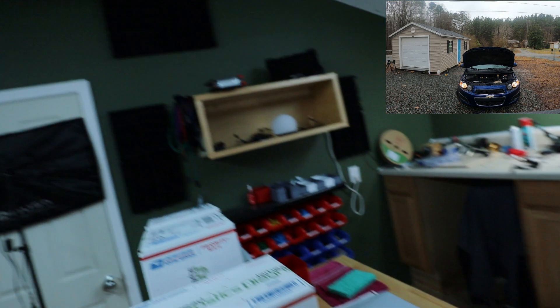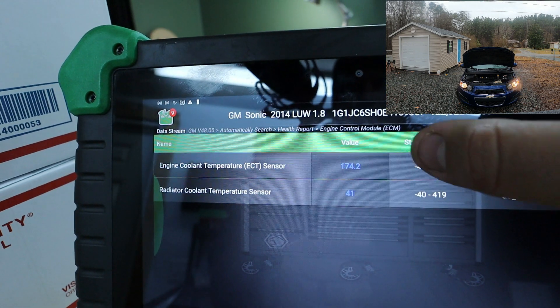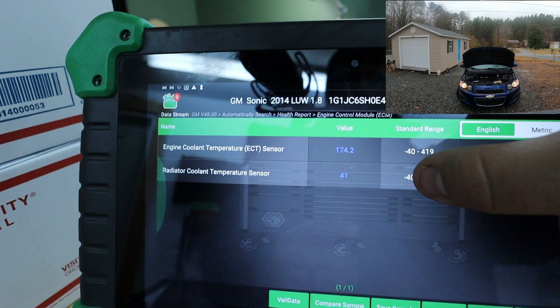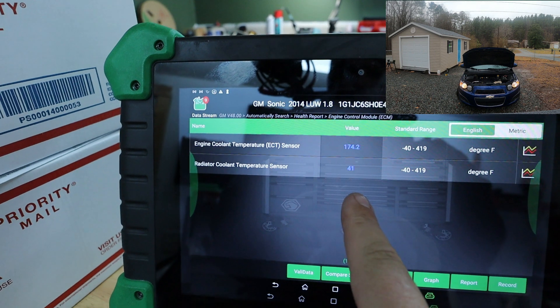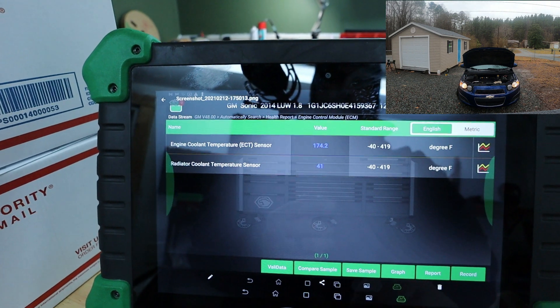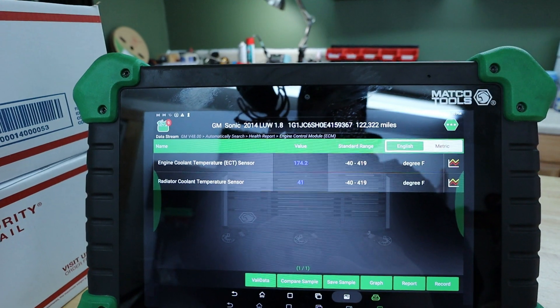This vehicle actually has two coolant temp sensors — one that reads the engine coolant temp and another one inside the radiator. After driving the vehicle for almost an hour and a half last night, it never got above 40 degrees, and right now it's still only reading 40 degrees after sitting. So that tells me I've got a faulty temp sensor. I'm about to go out and test the temp sensor, and I might try a bypass to trick the computer into thinking the temp sensor is reading appropriately, and see if it will let me do all these tests. If it can, then that's our issue.